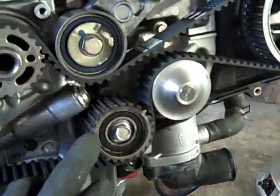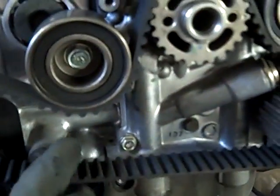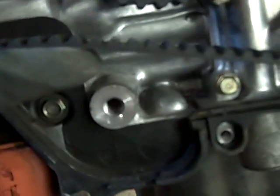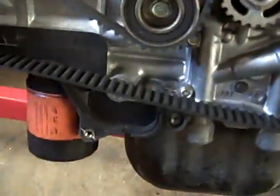I've got this pulley installed and things are getting really tight now. There's a lot of tension in this belt. The only place where there isn't a lot of tension is, you guessed it, the last place — where to do this one. In another video I've compressed this hydraulic tensioner so it's up all the way and I've got a nail — a nail that was just a little bit too big to fit through and I trimmed it down. Next we'll do that pulley.